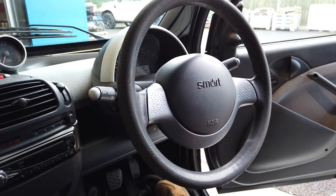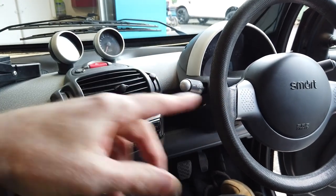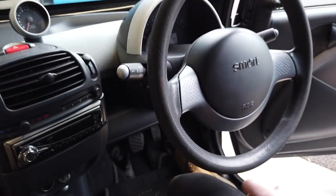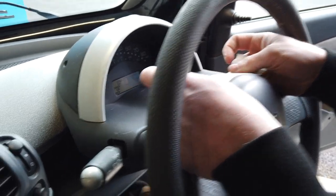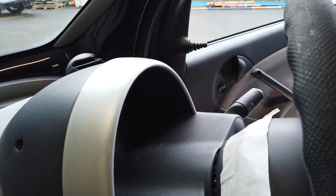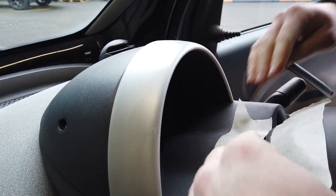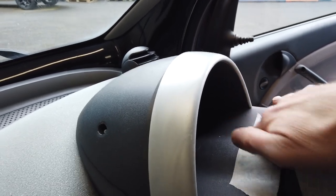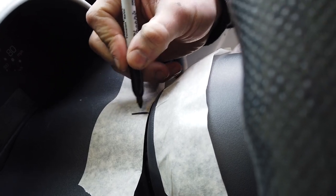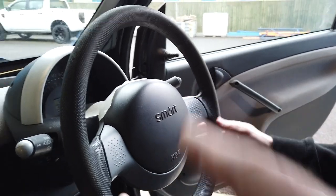Right, we're all cozy in our Smart car. The steering wheel on this car is on splines and you can get it repositioned any which way, so we're going to try to make a little mark on the cowling and the steering wheel. We're using a bit of masking tape - get it as close as you can to that bottom edge because you want to line the two up. We'll mark a line as straight as you can across there, so when you come to put it back on you can line those two up. When we take it off finally we'll double check.